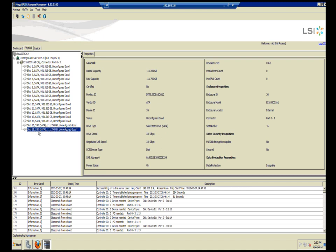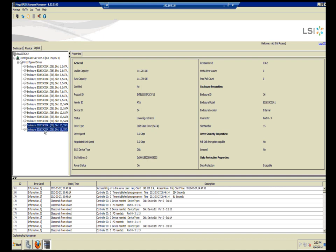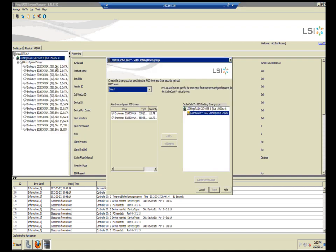Yeah, so basically, in practice, it's probably a good thing to do the SSDs first, because then you won't make the mistake of mixing SSDs with hard drives in your array, and we'll probably alert you to this. Right. Well, you notice, I couldn't do it. It wouldn't even select the SSD in my array when I did it. It's not something you want to do.